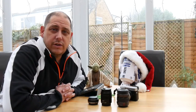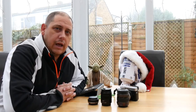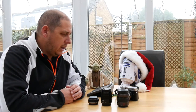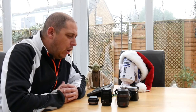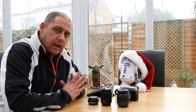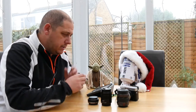Hi and welcome to GRVO TV - G's Reviews, Views and Opinions. I just want to do a quick video on adapting lenses for the Micro Four Thirds. This is something that's fairly straightforward, and the only really important thing is the distance between the back of the lens and the sensor, which can easily be adjusted by the use of adapters.